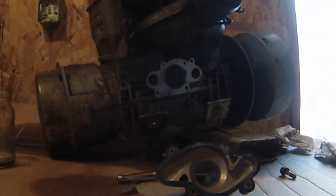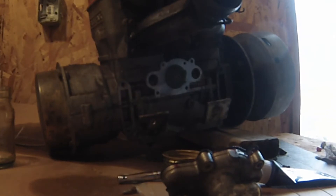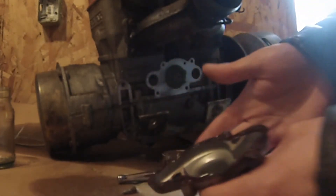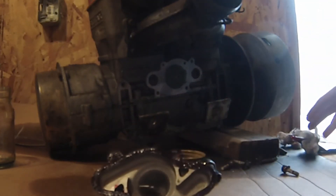Here's the housing — I just cleaned it out a little bit. There's some good old flange sealant. If you're like me and you can't go outside legally and pick up all the proper gear, the old gasket actually looked fairly fresh so I'm just gonna spread a little bit of this stuff on there. It's a little bit messy but whatever.